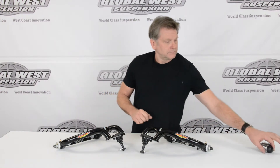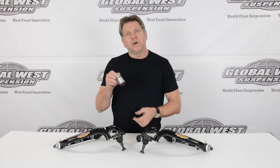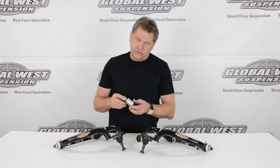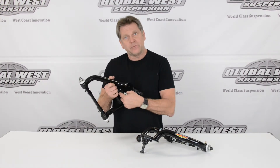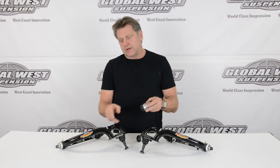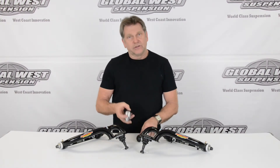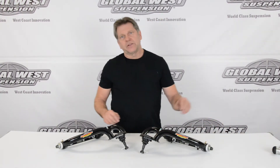There's one other thing I'm going to show you. These here — the part number is TLC-1100. I'll explain these in another video, but this actually takes the place of the standard bump stop. On a drag car, it acts as a limiter. See all these spacers? By spacing the bump stop down, you can actually limit the front end travel and droop. Some cars require that, so we wanted to bring this to your attention that it's also available for these applications.